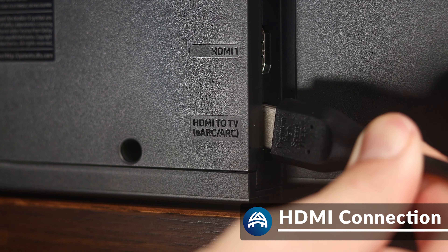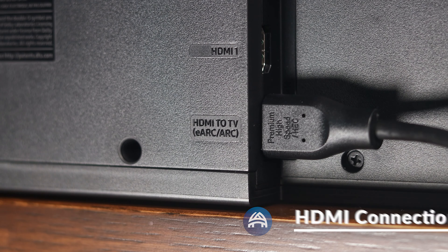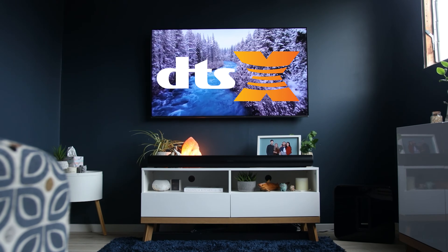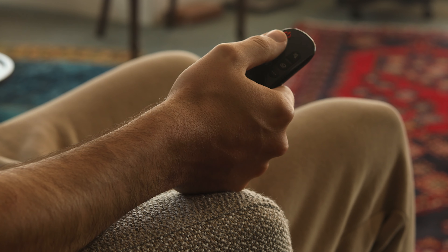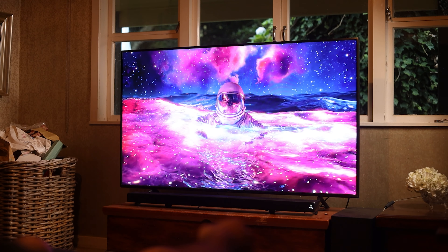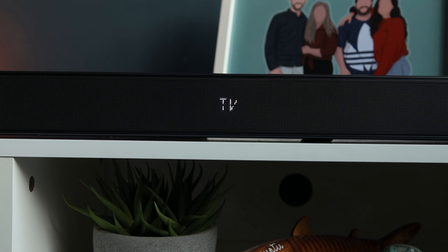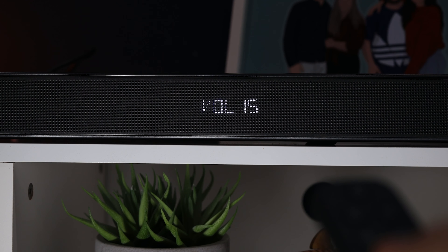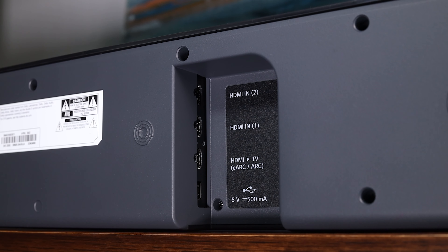Let's first tackle the ways to connect your TV and soundbar together. Using an HDMI cable is the best option for most people as it can give you the highest-end audio formats such as Dolby Atmos and DTS-X, but also lets your soundbar be controlled from the TV remote for a seamless installation. When you turn on the TV it'll send a signal through the HDMI cable to wake up the soundbar and volume level changing will happen seamlessly from the TV remote. It makes for an easy setup and is one of the major benefits of purchasing a new soundbar with an ARC or eARC connection.